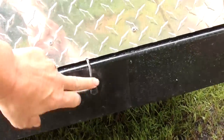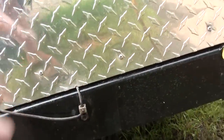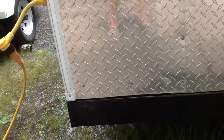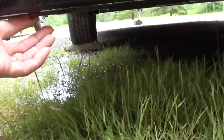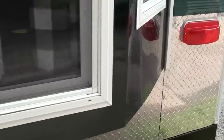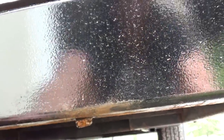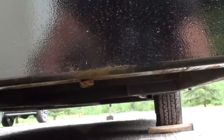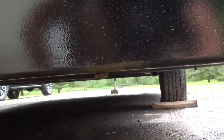Back here is also a ground point that you have to make sure is clean. That's obviously pretty easy to get to. And there's one bolt like I showed earlier under each taillight. When I took my bolt out on the other side — I've done one location so far — about five gallons of rusty water came out of my frame. So I'm also going to drill a weep hole in the frame so it doesn't just stay wet in there. That was kind of an unexpected surprise.